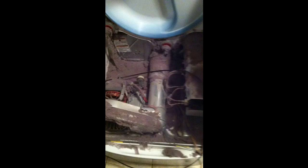We'll inspect the rollers and any bearings that need lubricating, we'll do that. After we finish, the whole dryer is going to dry a lot quicker and the homeowner is going to feel a lot safer. Here, that's inside the heating element — you can see it's all burnt.